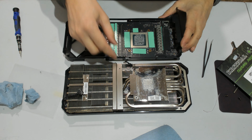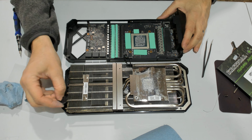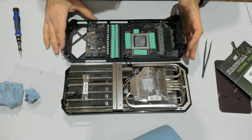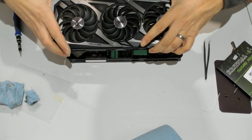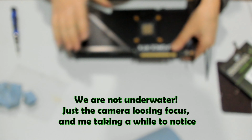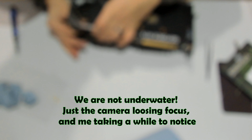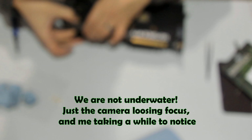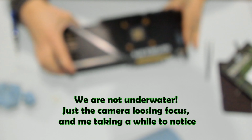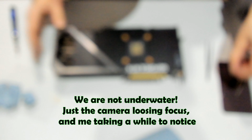All right, so before you close it, put back the connector, that one, and then we'll put that one back as we put things back together. You have 4 pins that you basically need to center into those holes. If they're centered, then things go straight in. So let's go do that. Flip it, you can see the 4 pins came through. Before we tighten up everything, let's try to put the connector back together. Okay, we got it. Back in, we can apply some pressure to make sure there's good contact before we put the screws. And now we have the bracket and 2 screws to put in, and we'll be done.